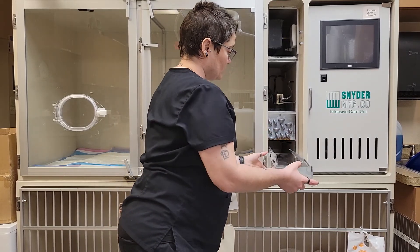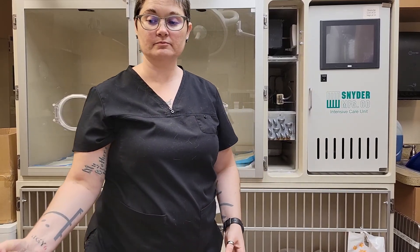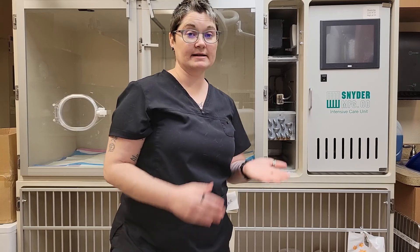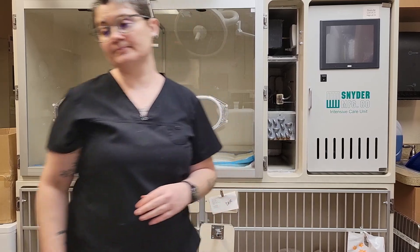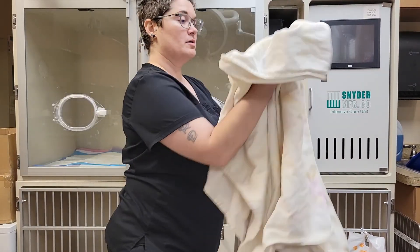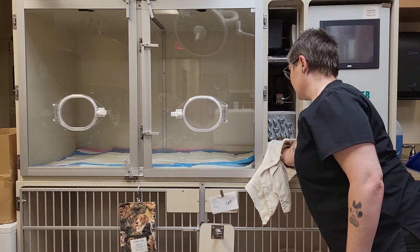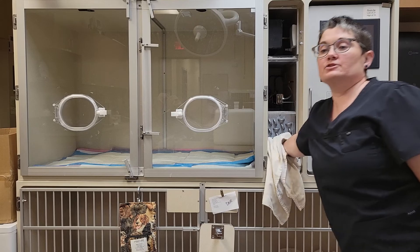Now we're going to empty the drip tray. We're going to fold the two flaps inward and then pull it out. We're going to make sure that it's dry. If it needs dumped, we can dump it in the sink. Then we can take a towel and touch the bottom side of the coil. If our hand is wet, we continue to dry by patting the underside all the way down. You can get a towel, reach all the way in to the very back, and then gently pat the underside, trying to get all the moisture up into the towel.